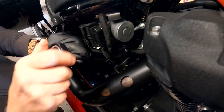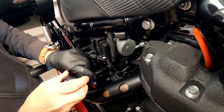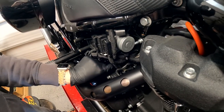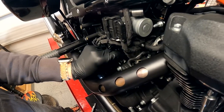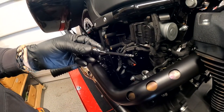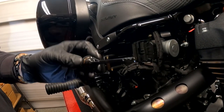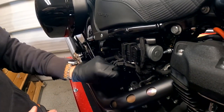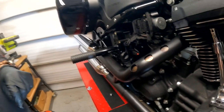I can just start to turn it loose, and then because of the universal joint I can get that out. Once it's loose it just comes out real easy by hand. In case you haven't seen one of these before, this is what it looks like — a little plastic dipstick, that's all you get. So that's where I'll put in the transmission fluid. And then the primary case — we'll have a special funnel for that.